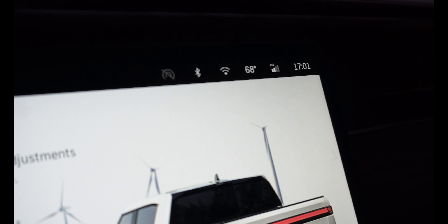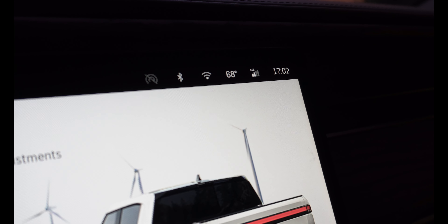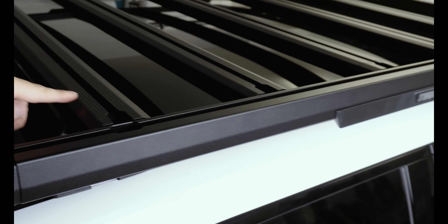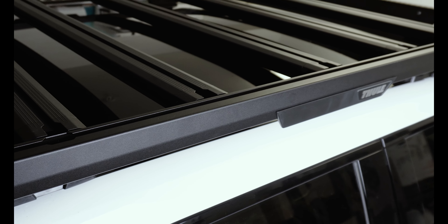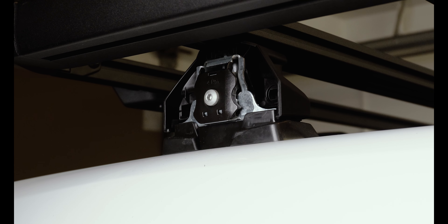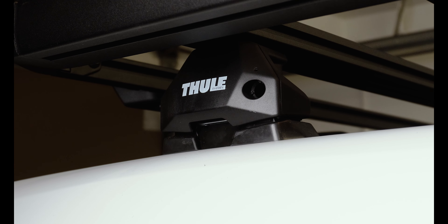Taking a quick look at the LTE signal — we're still at two bars, so it looks like it's going to be fine in the position it's in. I'll definitely keep an eye on this going forward, and there's adjustability in the platform so I can slide it forward if something isn't working right. I've got the rearmost crossbar locked down and the front one tightened up so I can go back and space out the middle three evenly, distributing weight and spacing evenly on top of the rack. We're on the final step — putting the caps on the brackets. If you have a lock you install that here; if not, you get this plastic piece that screws in with a flat head and locks everything into place.